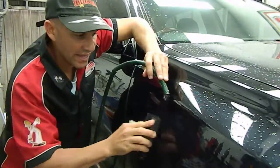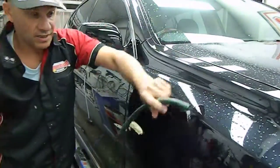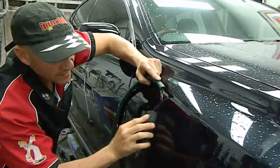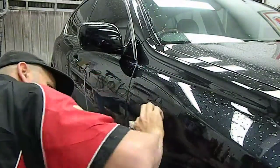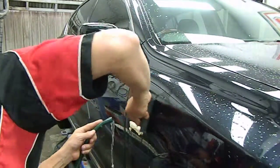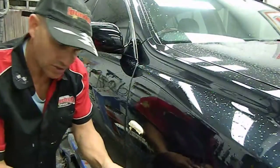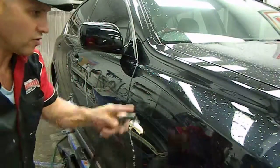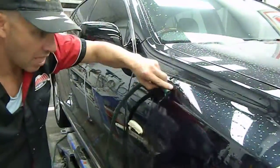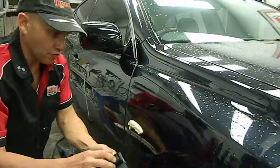The idea is to level that paint, that mountain of paint we've put on there. We don't want to sand too much, because we'll end up going through the paintwork and you'll see the undercoat on the good paint that we haven't repaired. So we'll take it a bit easy. You've got to be careful because it's quite easy to ruin the paint on this panel. You've got to rub it and check it. If you don't check it, you'll rub through.